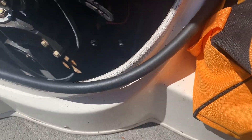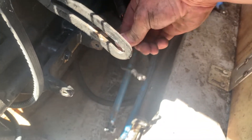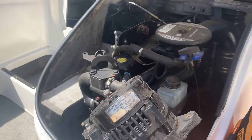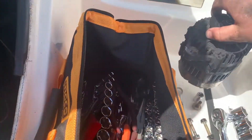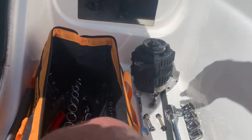Half-inch bolt, nine-sixteenths nut, lock nuts — just a through bolt here, through bolt there. You have three different wires: a ground going to the base of the alternator, your charge wire, and your signal wire. The alternator pops right out — horribly dirty one. This thing growls, so definitely a good time to replace it before I have problems.